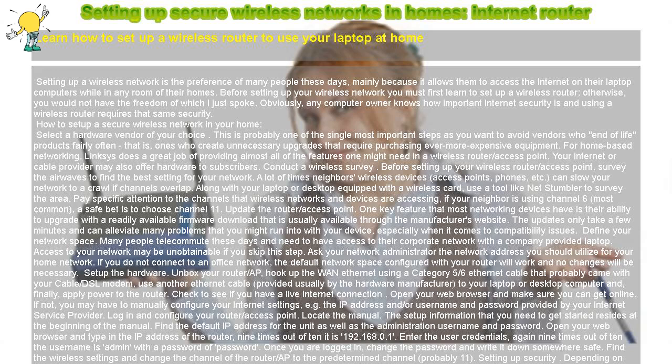Other things to consider: placement of your router/AP can have a significant effect on the performance of the device. Try to keep the device away from microwaves. Avoid hiding it in a metal desk/closet, and keep in mind that older homes with thick plaster walls can sometimes inhibit the use of a single wireless access point in your home, especially if it is a very large house. Look into adding repeaters or other access points if this becomes a problem.